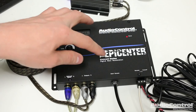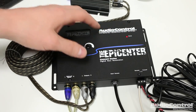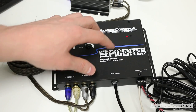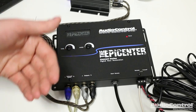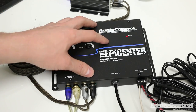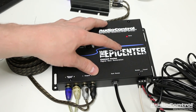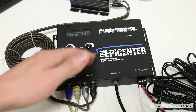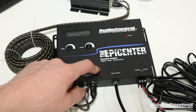Inside the device, there are a couple of other settings for more advanced system design. The first is an input grounding selection, where you can choose between balanced or unbalanced RCA style connections. If you find that you're experiencing alternator whine with this device, there's also a ground isolation jumper that you can adjust. Finally, there's a bass output control jumper that allows you to increase or decrease the signal voltage of the bass restoration circuit.